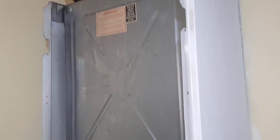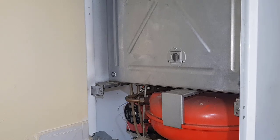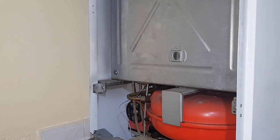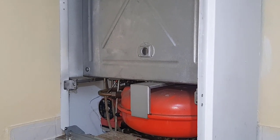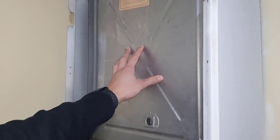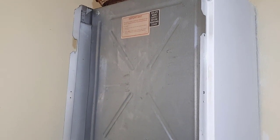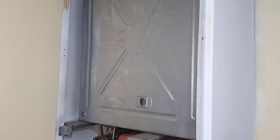So now we're going to look into why we're not hearing the noise of the fan. So Miles, what are you going to do next? Well, next we need to test the fan, so we need to get to it by removing the cover here and using the multimeter, testing the connections on the fan.